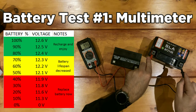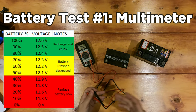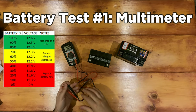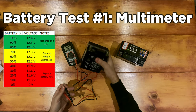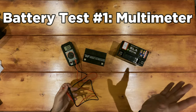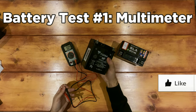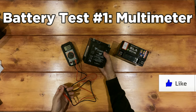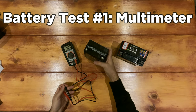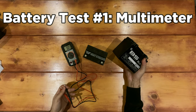This one is reading just about 10 volts. If it's in that yellow zone, your battery is on its way out. It really depends on the kind of life and treatment you've given it. If it's a fairly new battery from a good brand like YUASA, you could still get maybe another year or two out of it. If a cheaper brand is in the yellow zone, I would probably just replace it.